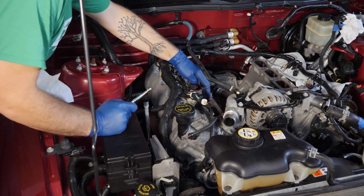Now we're going to attack the upper support bracket for the alternator. The alternator has two main mounting bolts at the bottom, and this bracket connects it to the coolant bypass, which is screwed into our heads — so this has to go. Remove the four bolts: 10 millimeter and 8 millimeter. Then push the alternator electrical connection out of the bracket. In an annoying turn of events, you can't remove the left bolt holding this down without at least loosening the alternator. So we loosen the two 13 millimeter nuts on the studs below — just enough to free up that space and pull that bolt out, without fully removing the alternator.